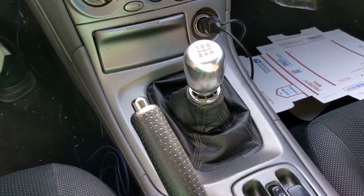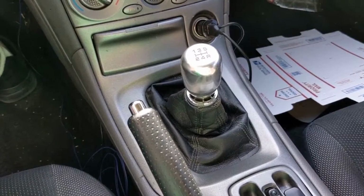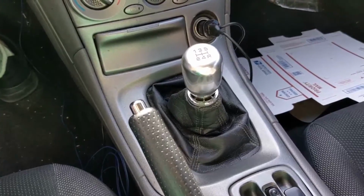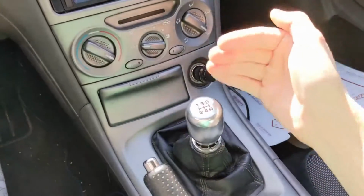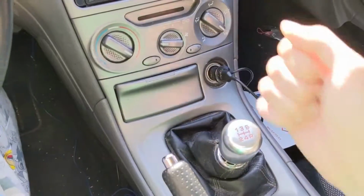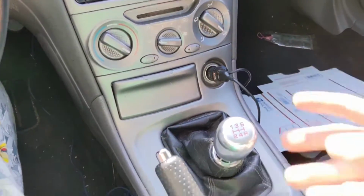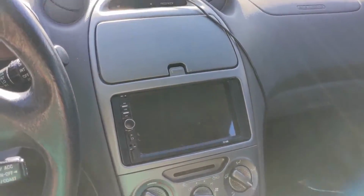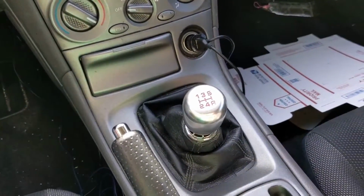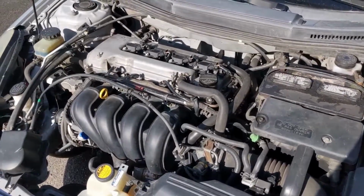As well as clutches, you can get like stage 1, 2, 3, etc. clutches. Obviously, if you're getting different clutches, they're not going to be as easy to daily drive, and with some clutches you could potentially blow your transmission. I'm not an expert on it or anything, but now that you have a better clutch that can send more of the engine force to the transmission, when you're shifting at higher RPMs, slamming that together, more of that force is transferring from the engine flywheel through the clutch directly through the transmission. So you could potentially, I don't know which part of the transmission, but do your research before that, especially with turboed cars. You hear someone turbo their engine and their tranny blows. That's because they didn't do their math, and usually you have to beef up your transmission some way or get a different one.